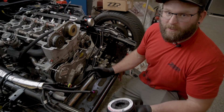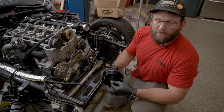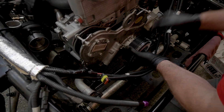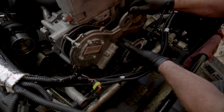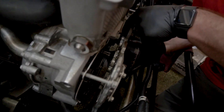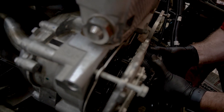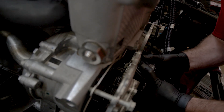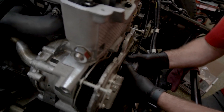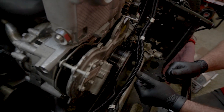With the cranks that we sell on a race block, we have the extended keyway. The ATI does slip enough that you can engage that first keyway. So when you have your front cover hanging here, you can get it through the oil pump gears, then peek over the top to see where the keyway is and start working your pulley on until your keyway lines up. Now with the first key engaged and the pulley started, you can just let the cover slide as you use your installer tool to press the pulley on all the way.